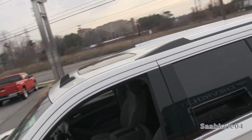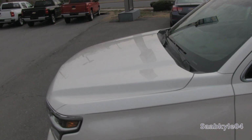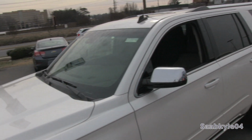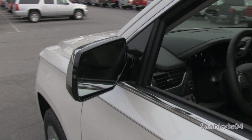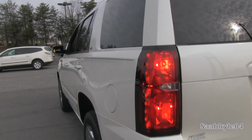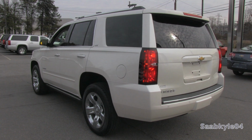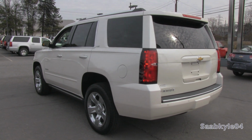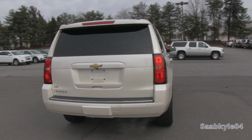The most significant advancement, though, is the addition of magnetic ride control for the first time, only available on the LTZ. The adaptive dampers work to reduce heave, pitch, and roll to give the best balance for ride and handling on any road surface. It uses magnetically charged fluid that adjusts the damping level proportional to the fluid's viscosity, up to 1,000 times per second, firming or relaxing it as needed to get the most stable, smooth ride a Tahoe has ever seen.